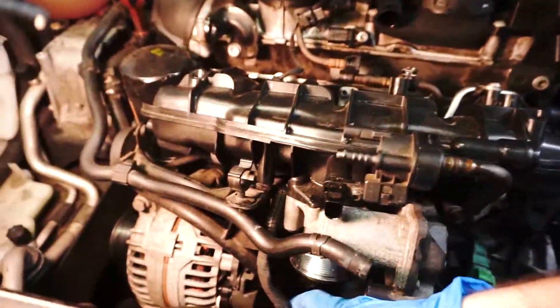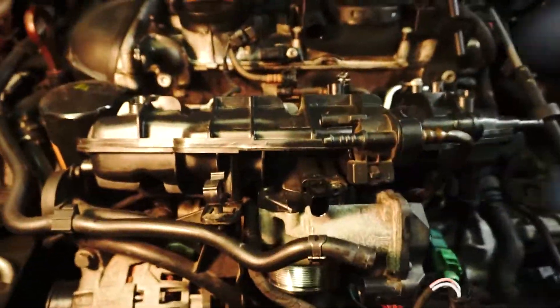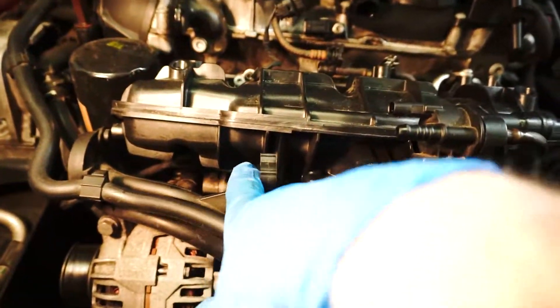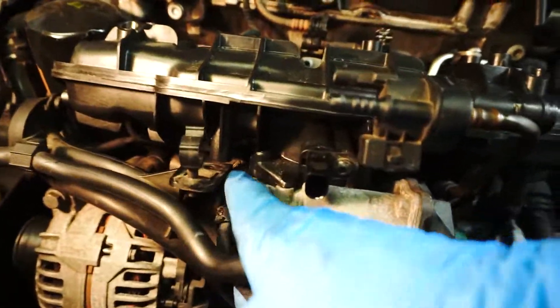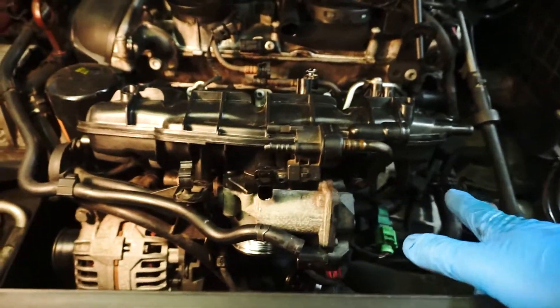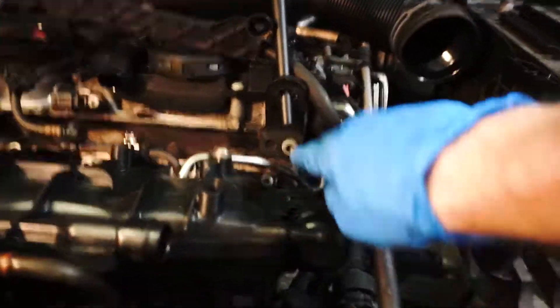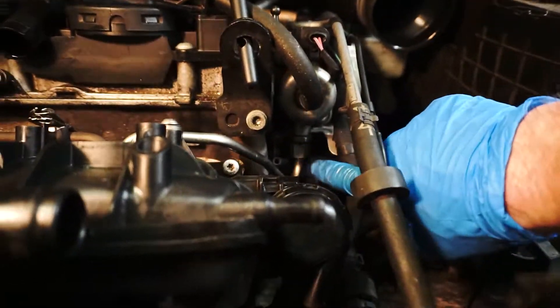We also have a 10mm which goes through the perimeter — one, two, three and four. There's also an electric line with all the connectors to the throttle body. The connector is going to be in the way of the extension socket, so you have to unscrew that little plate near the throttle body, then one at the left side of the intake manifold, then fish that wire down. We have five bolts at the top and four at the bottom. Before undoing those, we need to undo the line connected to the pump — I think it's 16mm.